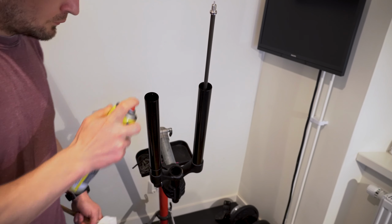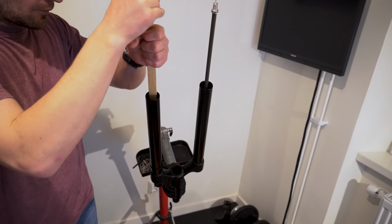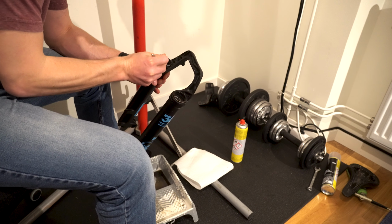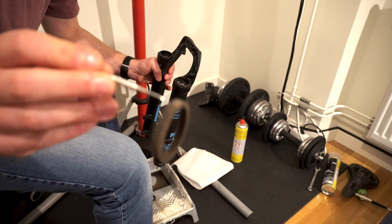The inside of the air leg can be cleaned with a paper towel soaked in alcohol, which can then be pressed through the air leg with a wooden dowel or any kind of stick, really. Now to get the old foam rings out. They sit right under the dust seals and tend to collect dirt that gets past the seals. And then they turn this wonderful crusty shade of black.